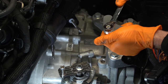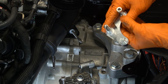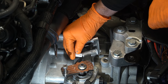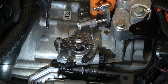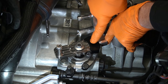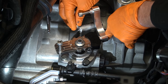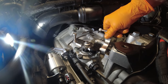Next up we need to tighten this nut on the end of our pin. Then we have to take our plastic slider bushing, slide the inner one on — you'll probably have to walk it in kind of like you did the other one coming out. Take the outer one and slide it in. Now we need to put a clip on here, but before you do that back the slider out a bit. Take the piece that says DAP on it and slide it on — it needs to go on like that. This is Delrin so you shouldn't have to lubricate it. Then take the clip from our kit and slide that over this pin.